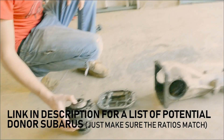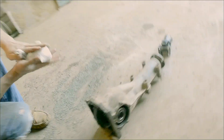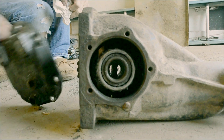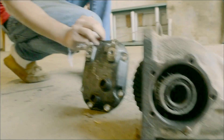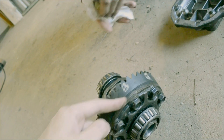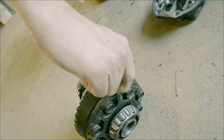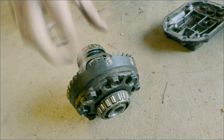Here's a trick if you're looking for one of these in the junkyard — there's a little flat ground into the cross pin shaft. If it's got that flat on the shaft, it should be one of these viscous limited slips. Some of them actually had a foil sticker on the cover that said LSD, but that falls off all the time. These are funny because they don't even look like a viscous limited slip — the only way you can tell is that this area is a little thicker, basically just from the thickness of this ring right here. A non-LSD unit won't have the seam — it's just a single piece, a little thinner in this area.